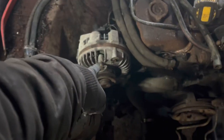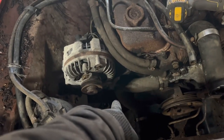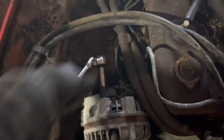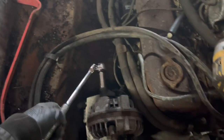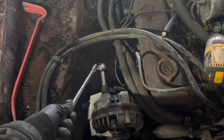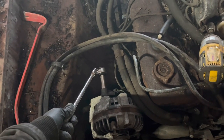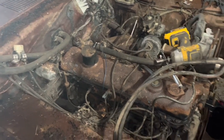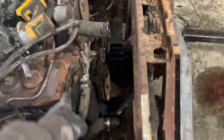The alternator is held on with one half-inch bolt, one nine-sixteenths bolt down there, and the output lug here — if it's stock — is seven-sixteenths. On some reproduction units I have seen a ten-millimeter nut here, I don't know why. The metric system. This car's history, and if I had a knife I'd just be cutting all these hoses. On the slant six, the two heater hoses run to there and there. The power steering pump often will stay in the car if you're going to put an engine back in, but I'm going to take it out.